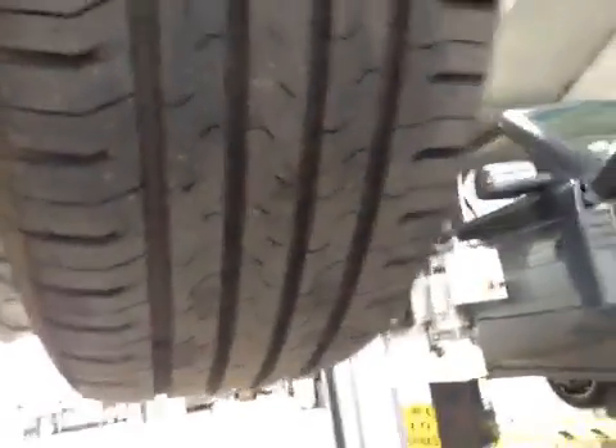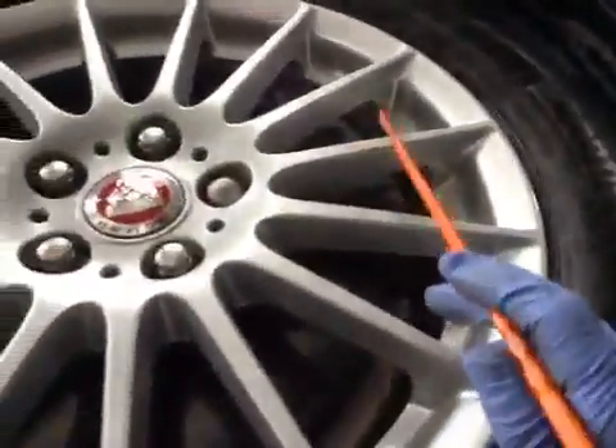All this tyre is in amber. There's no sign of damage on the other tyres. Front discs are in OK condition. Front brake pads are up at about 9mm. Pads are in green.